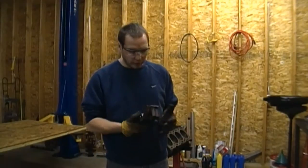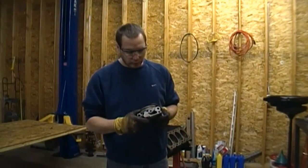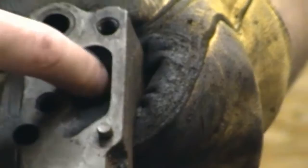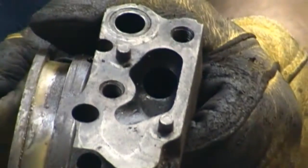In an effort to add something interesting to this video, I'm going to talk about radiusing the oil hole in your rear main bearing cap. Here it is, and you can see there's a sharp edge on there — it's basically a hole drilled in the surface. I'm going to go ahead and take a grinding burr to this and make it more into a funnel shape.